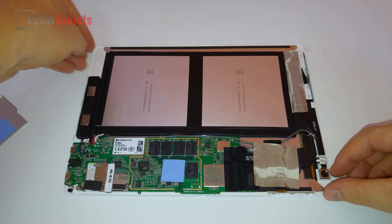They'll still give some contact with the back of the metal shell here to help transfer some of that heat away from where I have the copper and the other heat sinks. Now I put some IC Diamond 7 between the shielding and the copper here — just a little bit, a couple of dots in the middle each, so that should help transfer heat over. I'm going to put it back together now and have a look at the temperatures.